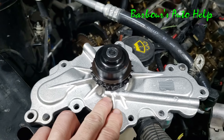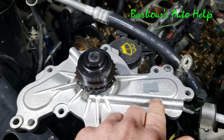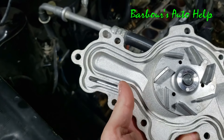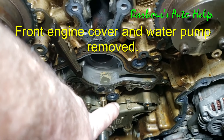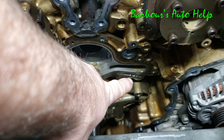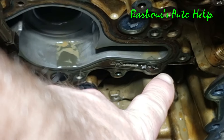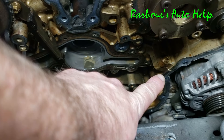Because this is inside the engine cover, they developed a special weep hole, and you see this little tube here going from that area over to the side. That's your weep channel, and if you look on the inside, that channel has a little slit right here that allows coolant weeping through the weep hole to be channeled into another chamber. That corresponding chamber on the back side is where the water pump mounts, and there's a tube right back there that goes to the side of the block — that's where it weeps out.